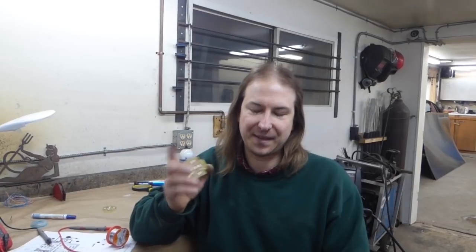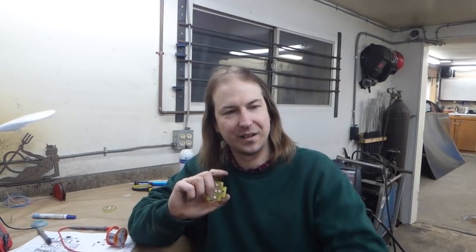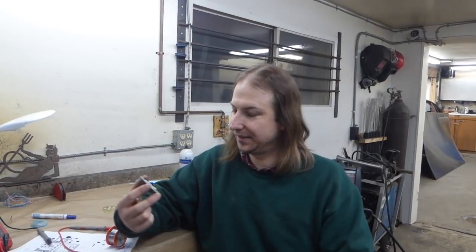And I realized what I did. When I was designing the board, in order to position the left LED, I accidentally flipped it instead of rotating it. Now, if you think about that for a sec, because it took me a minute to realize, when you flip something, you mirror it. Well, this is a polarized component. All of these pins do different things. You can't just mirror it. You have to rotate it so that all the pins stay where they're supposed to go. So, attempt number 3, I rotated the LED, and wouldn't you know it, it works. And that's the last bit of fab work needed on the cluster itself.